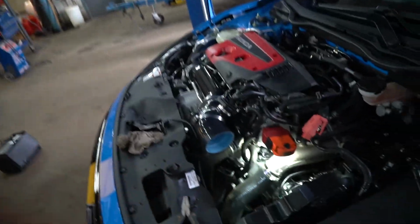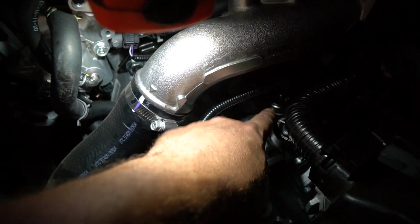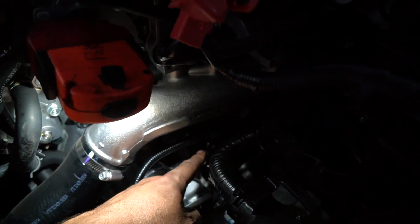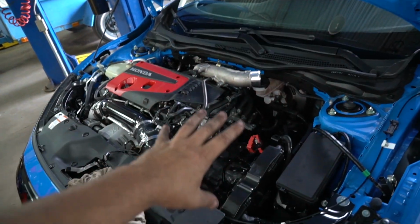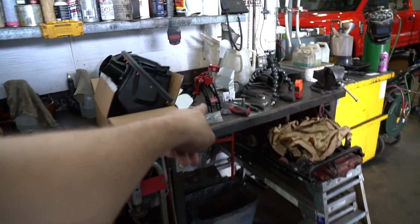Well, to be honest, I wasn't expecting to go this far. So far we removed the battery. The battery's right there, the bracket and everything. So one thing though, we have better access to the other bushing, and the worst part is it's almost completely installed. I just need to clip the C-clip underneath. Okay, so both bushings are installed, even though almost everything else in the engine bay is out, like the battery and everything. Now we are going to do all the same steps backward, reassemble the engine bay and go inside the car for the shifter install.